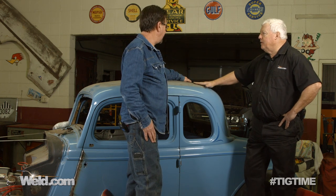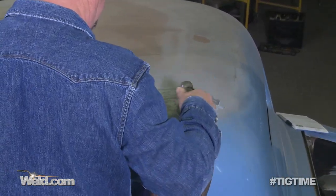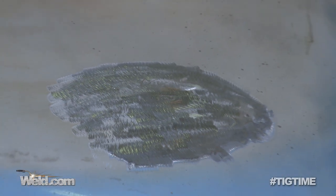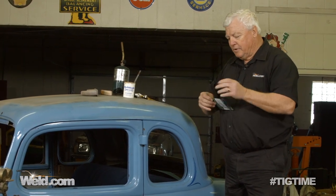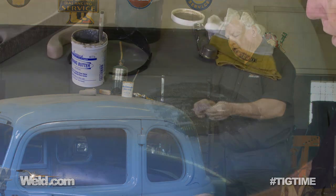Can you get this down to bare metal for me? — Certainly can, I'll start the process. Let me get my tools up here and we'll get on it. All right, I've got about a six-inch diameter around the spot we want to work there, down to the bare metal. I think it looks good, Tommy. I'll turn it over to you. The first part of this is getting it clean — you'll hear that from everybody that's ever done leading. I'm going to go ahead and use my Easy Wipe and wipe it down.